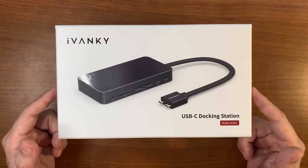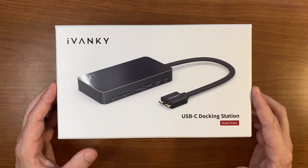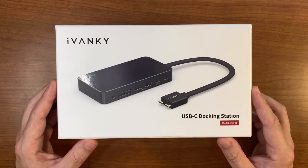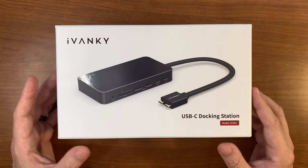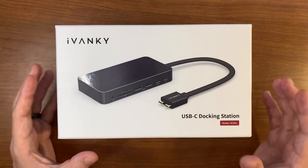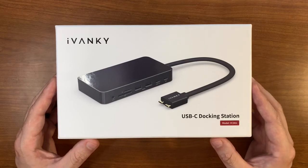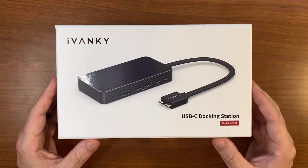This dock — what is interesting about it is it's targeted. Windows users do not experience the same kind of issue. A Windows user can actually plug in a standard USB-C or Thunderbolt dock that supports multiple DisplayPorts or HDMI ports, and Windows does support MST. So using a single piece of hardware, you can drive multiple external monitors over one single cable. That's where this little guy comes in. This was a Kickstarter project that I backed and it has gone successful, and it targets Mac users specifically — not Windows users — to drive multiple external monitors.